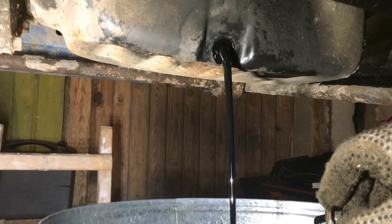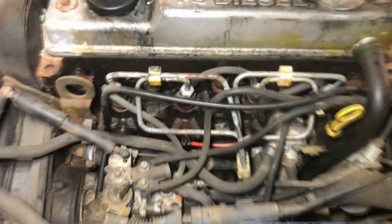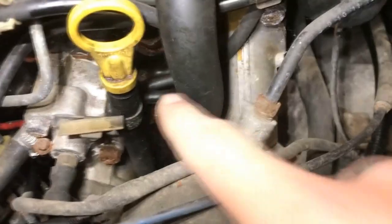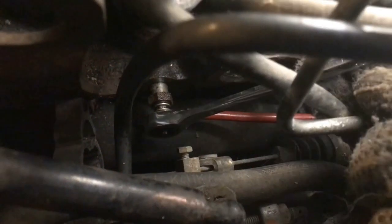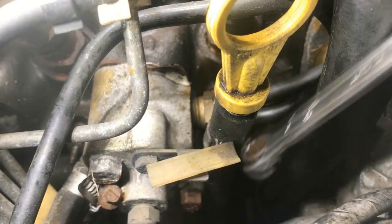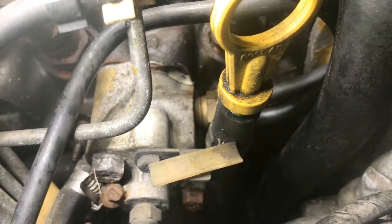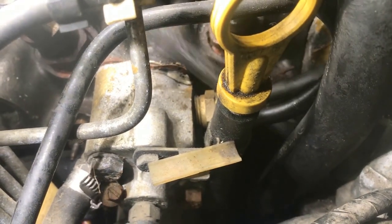As the engine is almost free from ancient oil, now we can move to the next part. We need to add kerosene to all cylinders, for removing hardened residues from piston rings. First of all, we remove all glow plugs. You have to be very delicate to do this uncomfortable task, but sometimes, it's necessary to use a hammer. Also, you have to be very patient and calm, because car repairing won't always be easy.